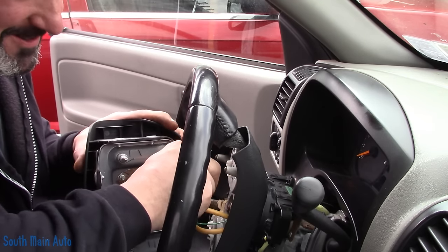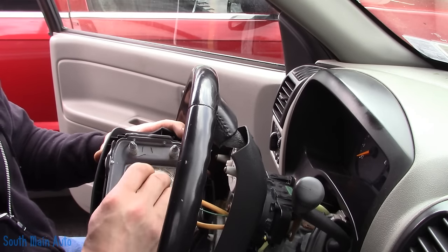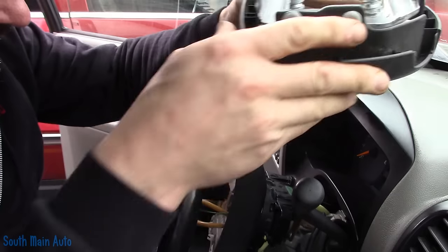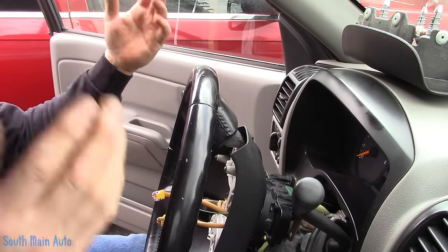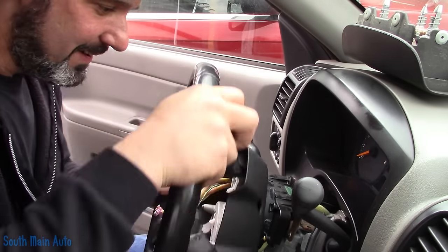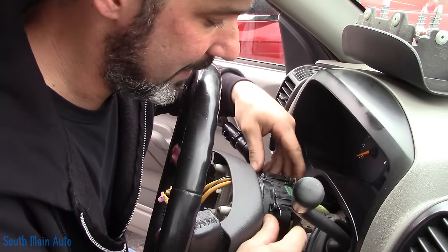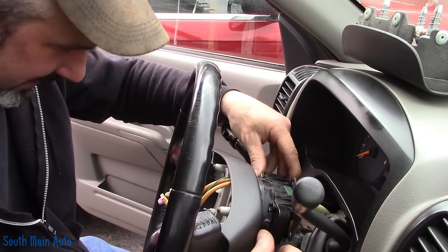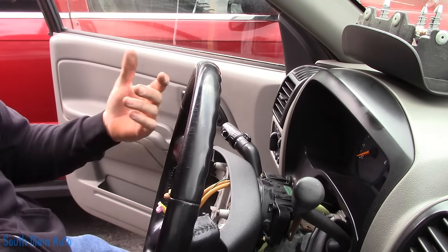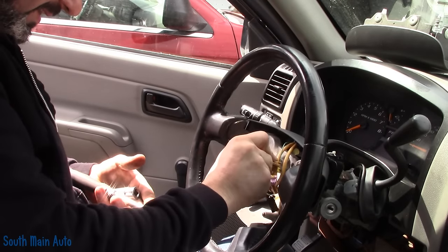Take that screw out, got the shroud loose. I'll show you once the airbag's off — it's a little easier. Push really hard, release. There's half of it — then you've got to come over to the other half. There are four pegs on this one, and if you pull wrong they all snap back in, so don't pull the wrong way. There by golly, we got it. So then we have to unplug the old horn, and then the dreaded airbag — sit way back in the seat.